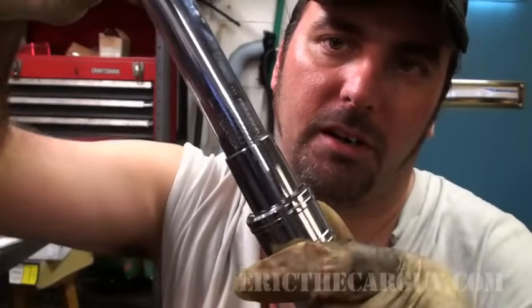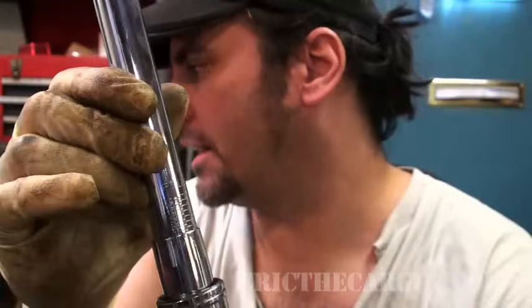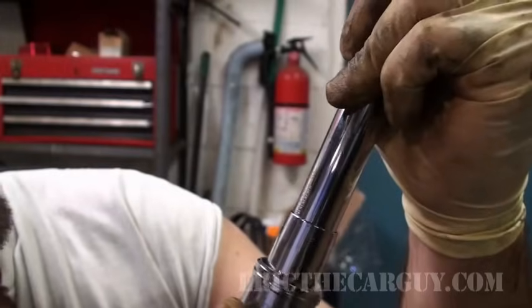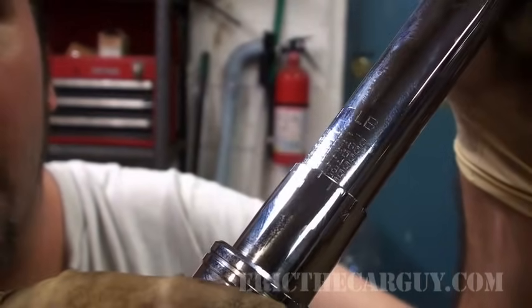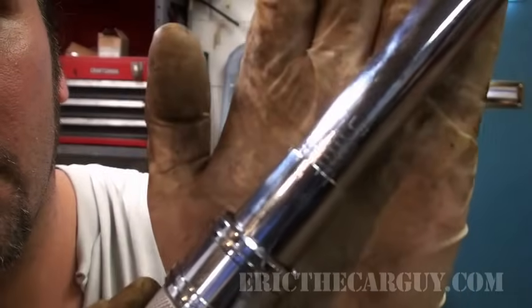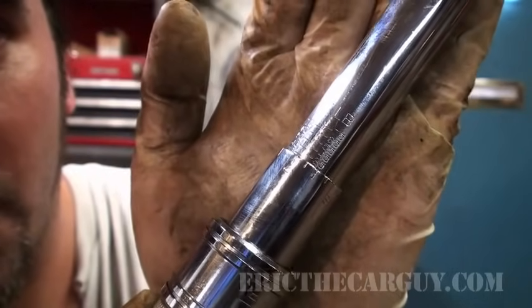And you set these on the barrel here. You can see a series of numbers here, and you basically turn it to the appropriate number. Say my first one is 29, so I would turn this up, in this case in increments of 5, so I'd go up to 25, and when you get there, you'll see that there's a 0 on the 25. So I'll take it up to 25, and then plus 4 would be 29, and then it'll lock into place there. Okay, so it's on 25, and then I took it up to 4, and that equals 29. So this will be 29 pound-feet of torque that I'll be applying with this particular wrench.